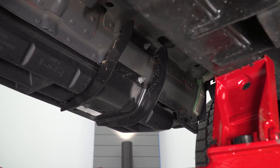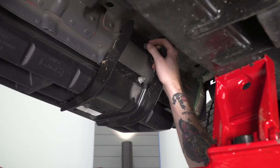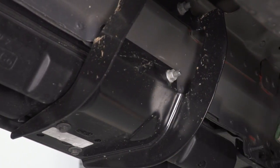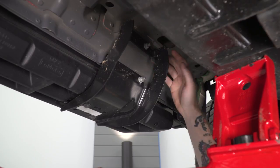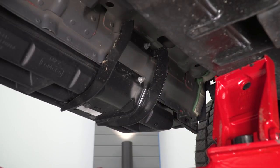So when I go to remove all of these nuts on the factory board, I'm actually gonna leave this top corner one here in place on either end. Instead, I'm gonna remove these bottom ones and these center ones. That way, since I'm doing this by myself, I can come back to this corner nut at the very end, I can let each one down by itself, and I can let each corner of the factory board come down gently without the whole thing crashing down.